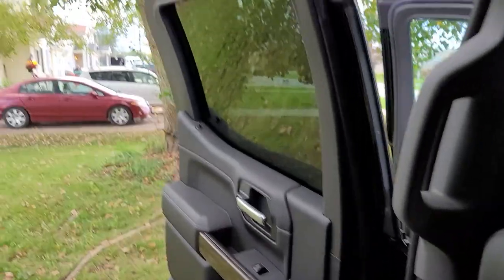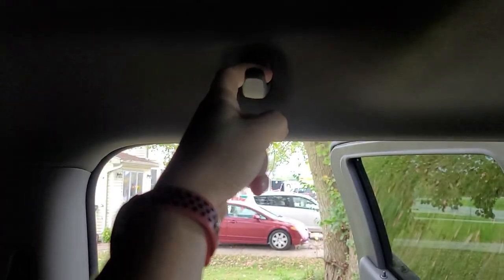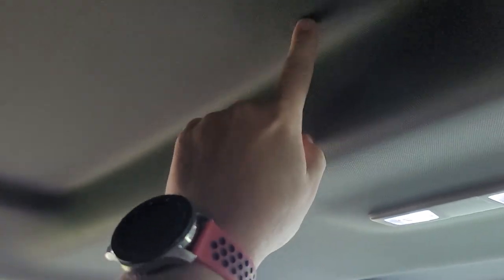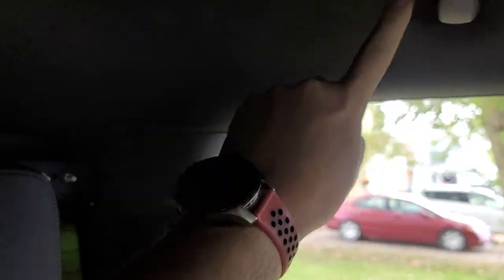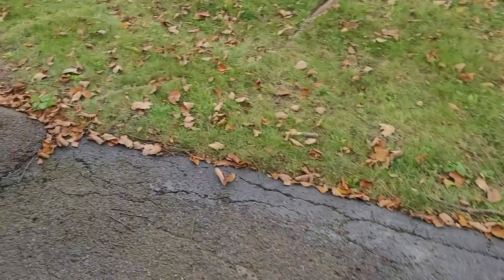Basically what I did was I pulled the liner from the side here. I took the clothing hook off and pulled the liner down, and was able to get over into the center area, which is right up around roughly where the antenna is. I ran the coax across and down, and it comes right out of the hole here for the seat belt, and then gets ran around the whole truck to the radio.